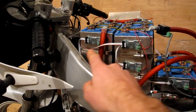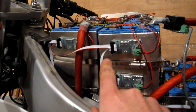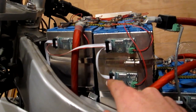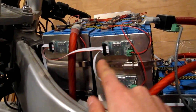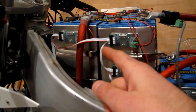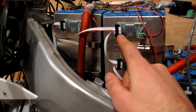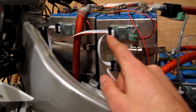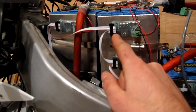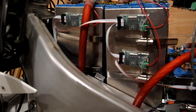They're all interconnected with this ribbon cable. What it actually is is a ten-pin ribbon cable split into two, so it's a five-wire interface — one wire comes in and one wire goes out. The only disadvantage of setting this up is that as you go along crimping down these ribbon cable connectors you kind of just need to know how far away the next one is, and make sure you crimp in another cable at the same time to go to the next remote.